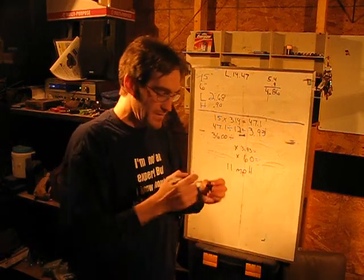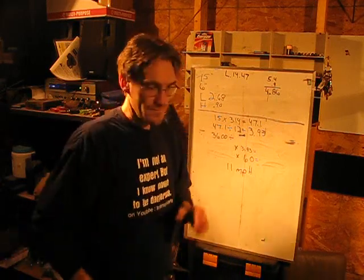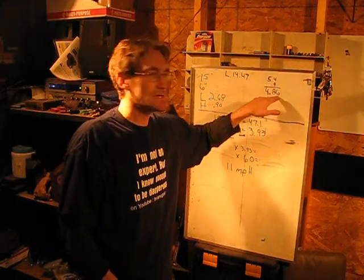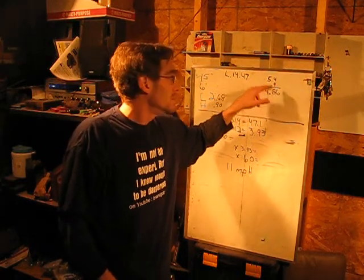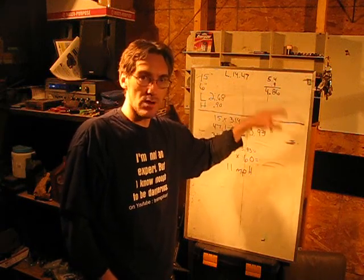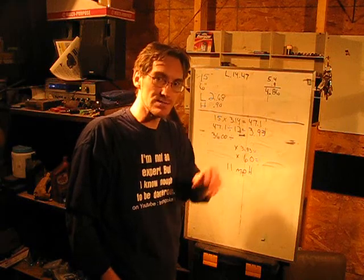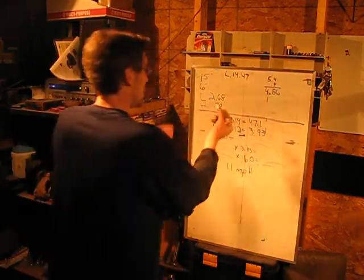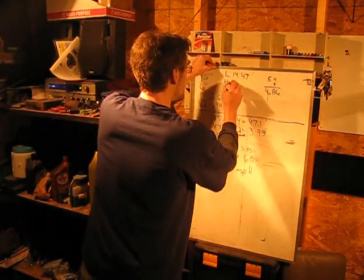That's our ratio at the high end. That means that when the torque converter is fully engaged, this is the total ratio you're going to have, as long as you have a 10 and a 54 tooth. Now the sprocket ratio is going to change. These numbers are all going to change based upon what sprocket ratio you use. So our high end is going to be 4.86.